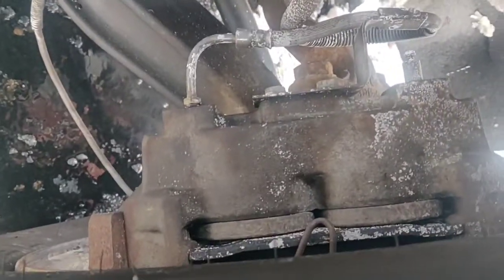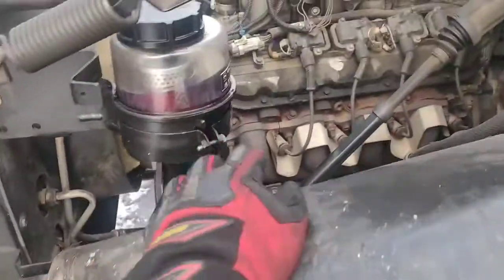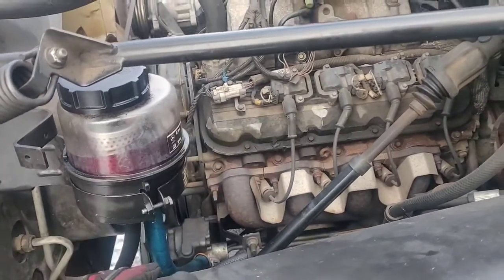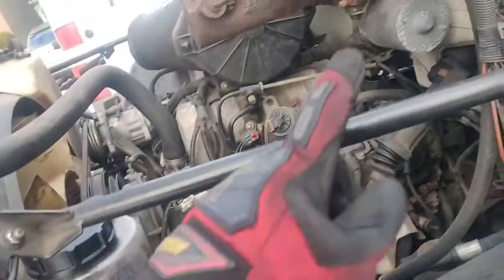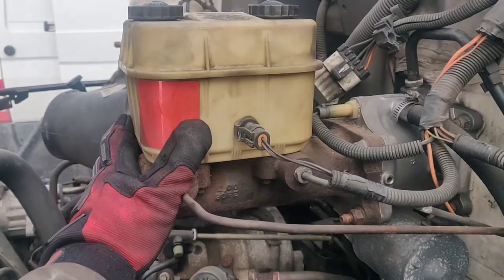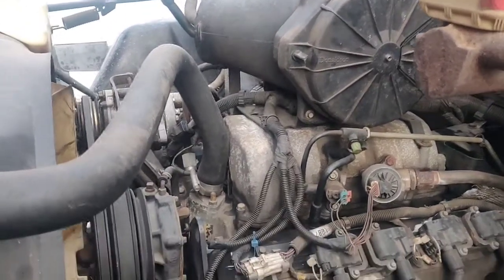Either way, these trucks have plenty of power — this is what U-Haul uses, so I'm sure a bunch of you are probably looking at these at an auction site and you can get them pretty cheap. You'll need to look at the brake and make sure it's not leaking — that's your hydraulic pump. You'll be using automatic transmission fluid for pretty much everything: your steering, your hydraulic pump. And you'll need brake fluid DOT 3 for up here. Oil-wise, it's 5W-30, I believe.